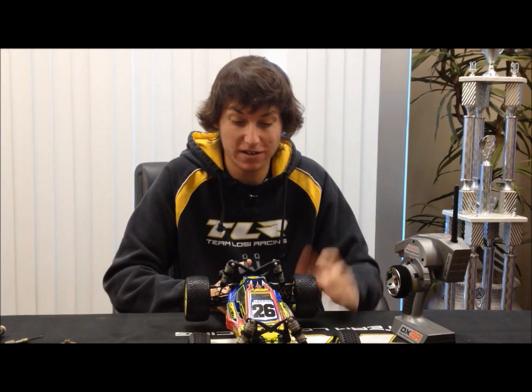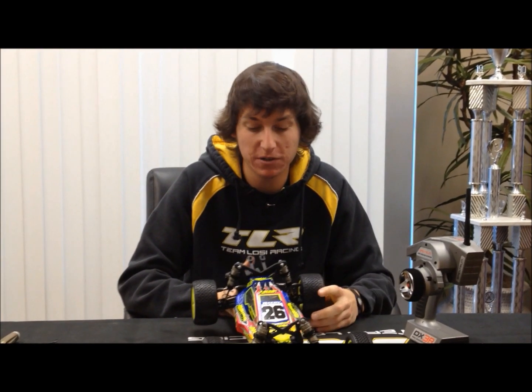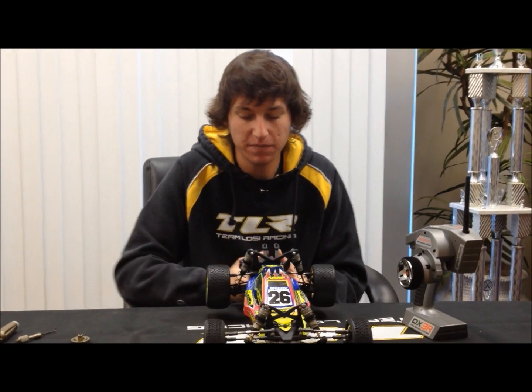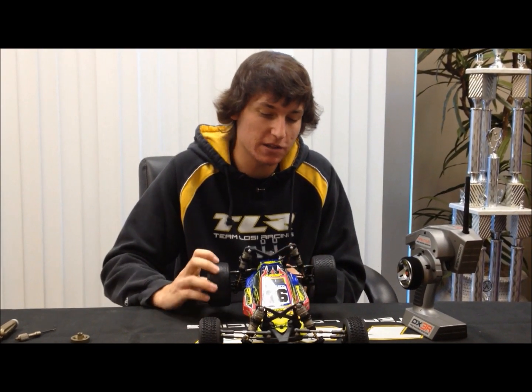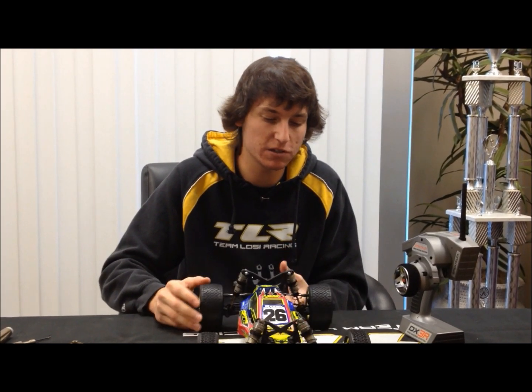All right, we've completely broken in, rebuilt a new diff. We went through how to grease it, what grease to use, how much grease to use, how to break it in. I think the biggest thing is just taking your time building it. Don't rush through it. And take your time breaking it in. I think that's a big part of it, and slowly come up on your diff tension while breaking it in.